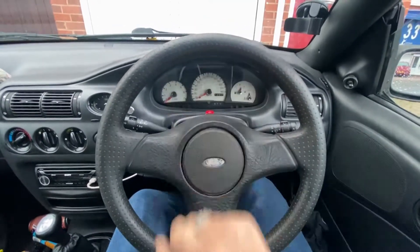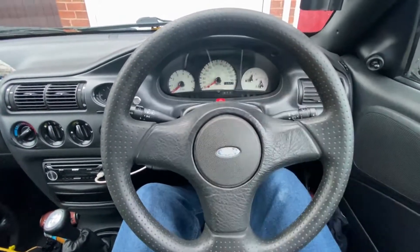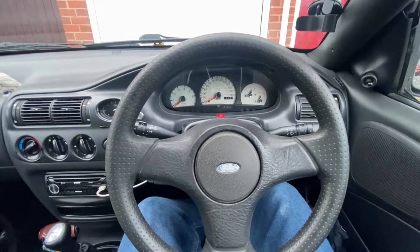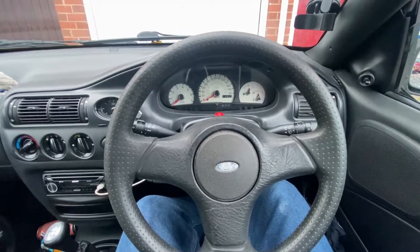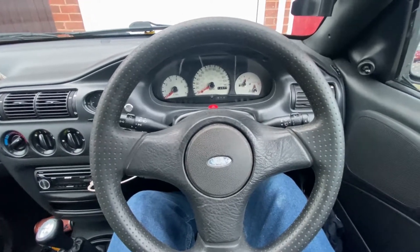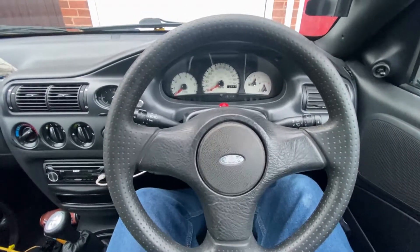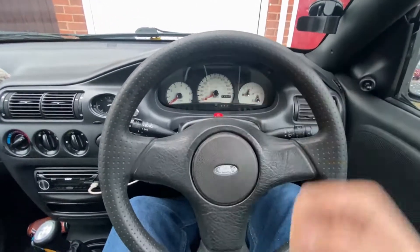We're now back in the car, the steering wheel's fitted. Does the horn work? Yes it does. Now when we switch the ignition on, an airbag light's going to start flashing on the dashboard because we've removed the airbag. Technically speaking for an MOT, that airbag light should come on and then go out. If it stays on indicating a fault, that's an MOT failure. So technically, because there are now no airbags, there's no need for an airbag light — we can just remove that bulb and there'll be no problem.